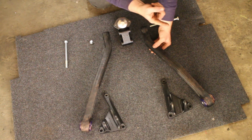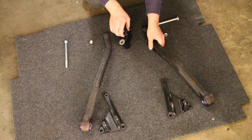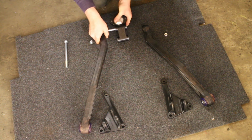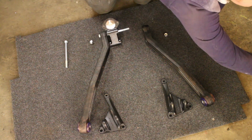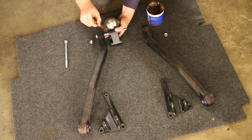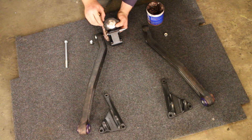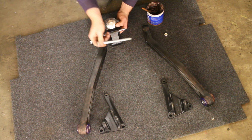Right, so the arms need to kink out and upwards, so this is the correct orientation. I'm just going to put the bolts through. Quite nice long bolts these. To help with future repairs, surfaces and bolts have all been smeared with copper slip. It should offer a little bit of corrosion resistance too, though we are using our M1 spray, the corrosion spray, on every fixing.